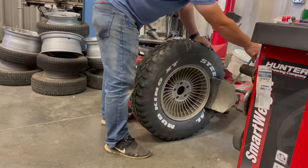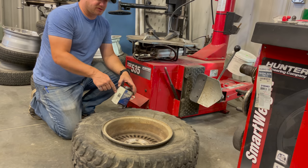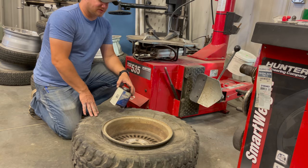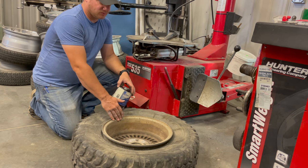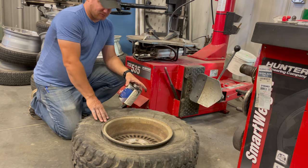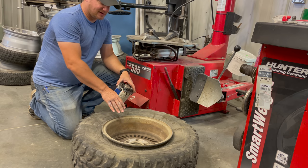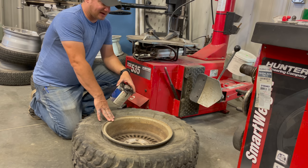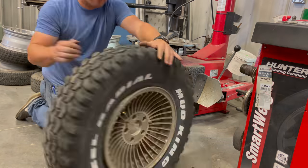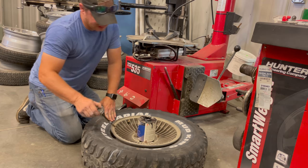I found the missing 13mm socket. My tires are starting to go flat now, so instead of ruining these tires completely I better get them off and do something about them. I wanted to put some inner tubes in these tires so I didn't have to rely on the old tire to hold air, but because of where the valve stem goes into these wheels, an inner tube wasn't going to work. So I'm just using a bunch of bead sealer — I'm going to seal up the sides real well. I'm also putting in new valve stems. If the valve stem and bead sealer don't keep the tires from going down, I'll have to resort to slime or some other option.